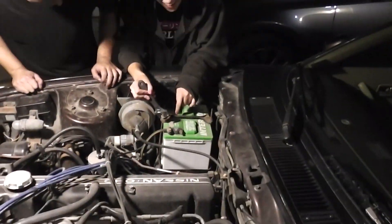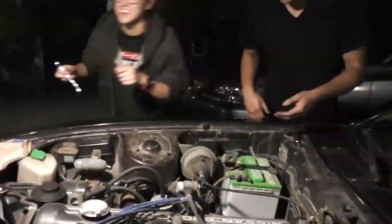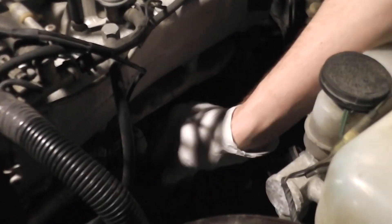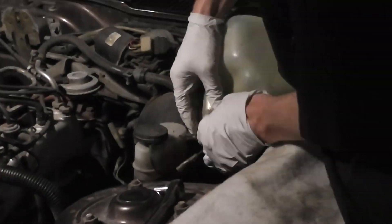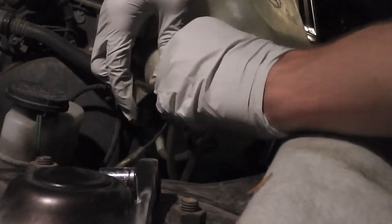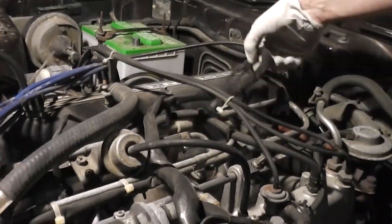The first step in the process was to remove the entire factory EFI harness and ECU. It wasn't all that difficult, but it was time consuming. The factory harness is tucked in a way where a lot of engine bay accessories had to be removed in order to gain access — like a lot of heat shields, the washer tank, the hood latch, stuff like that. But once that was done, I could simply disconnect the harness connectors from the EFI components like the injectors, idle air control, TPS, etc. And then all I had to do was remove the harness itself from the plastic clips holding it to the body.